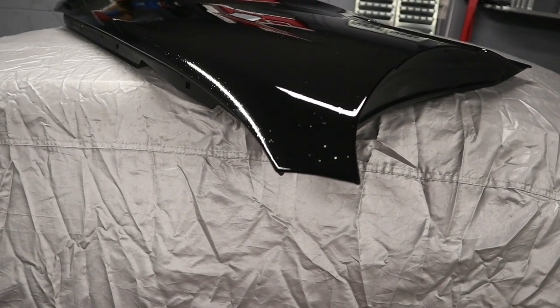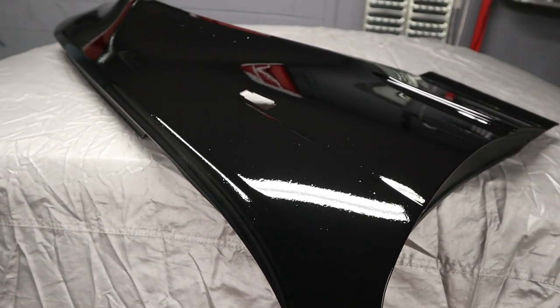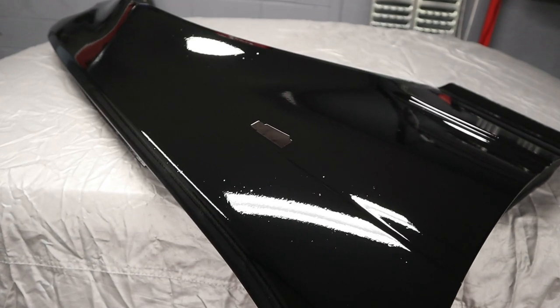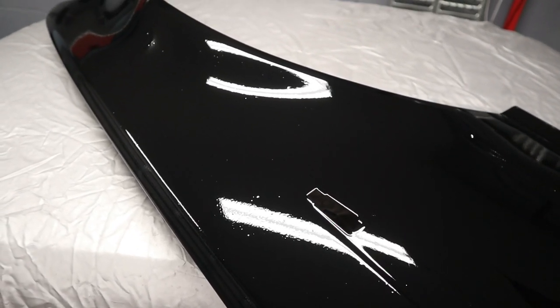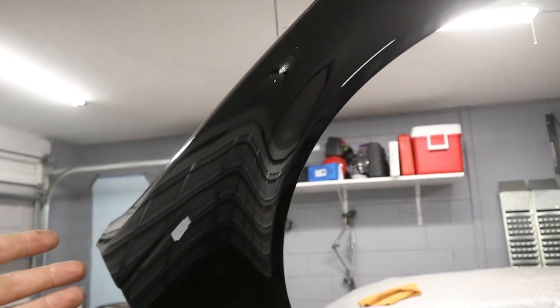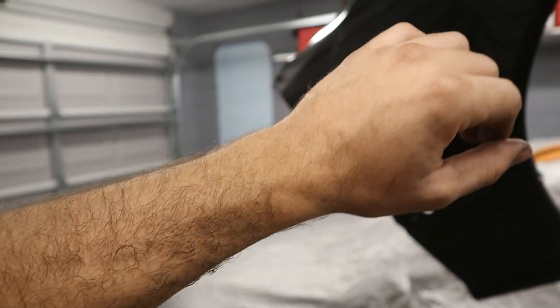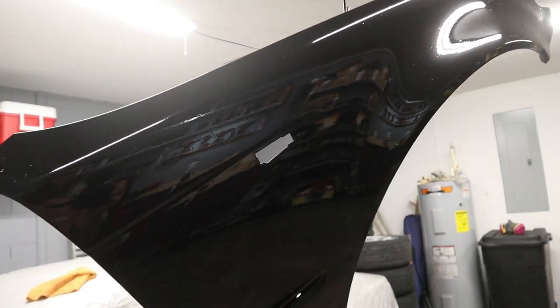I think you're supposed to wait on average like 1 or 2 weeks before you get into wet sanding clear coat like this. But the places where there isn't any debris in the paint, the orange peel looks super good. The clear coat went on great. I got a little bit on my arms and it stuck the hairs together. But man, it lays on great. It dries great.